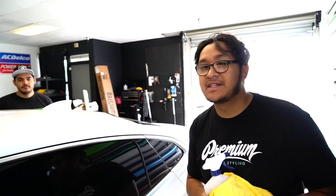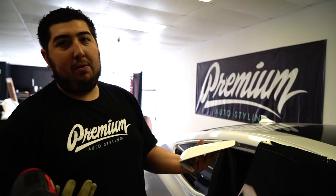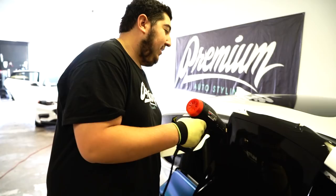The main thing to remember when you're wrapping mirrors using this preheat method is we're not stretching — we're just using the heat to get it nice and conformable. So when you pull through, it basically just conforms. We're not gonna be forcing the mirror cap through. It's actually just really light pressure. With it being heated like this it gets soft and it's able to just basically fall onto the material. The only stretch is a little bit of a pull to get this hard angle, but it's gonna be gently pulling it into place, not stretching it.